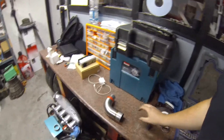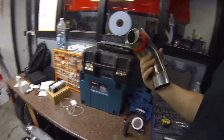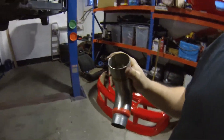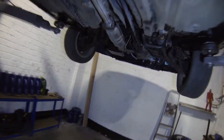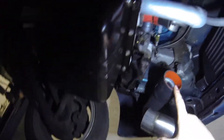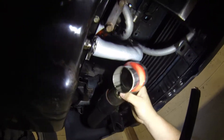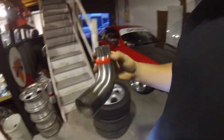I have been busy on the Civic — don't think I haven't been! The intercooler's nearly done now. You might have seen we were waiting on one last size because the outlet on the turbo is like two inch and the intercooler is two and a half. There's the intercooler and you can see there's the feed — that will go in there and then that will go in there. I've just taped it up for now so when I take it to Chezzy tomorrow he'll be able to weld it up for me. Then I can paint it black, fit it to the car — I'd say that's the intercooler done.